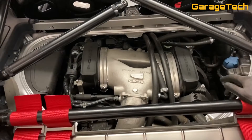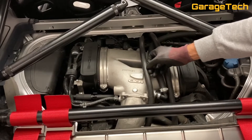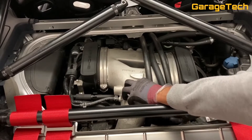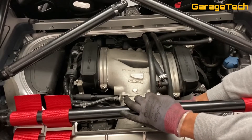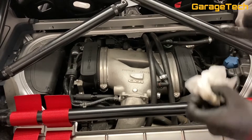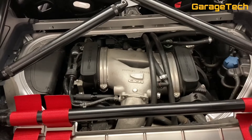I'm just going to stick some gloves on. The other thing I want to do is actually check inside here into the plenum chamber or inlet manifold to have a look to see how much oil is actually coming back in to the system. I suspect there probably will still be a little bit because it's never going to vent it all out. Easy way to do so — I'm just going to stick my finger in there. You can probably just about see that my finger is wet. So there is still some oil which will be getting back into the system.